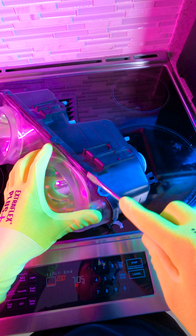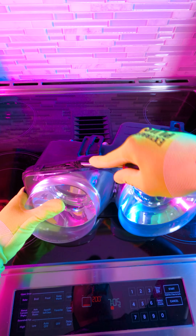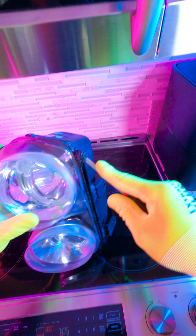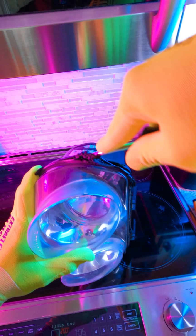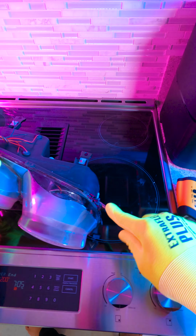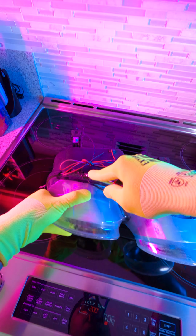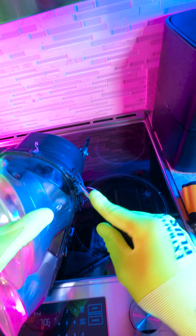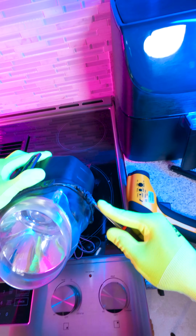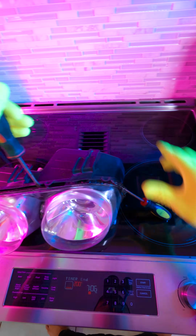Now we're gonna take our screwdriver and we're gonna run it around the headlight. Okay, we're just gonna go on the sideway action like this. Now don't poke yourself because that could happen, but that's why you have gloves too, right? So just go around the whole headlight. Now we're not trying to remove the butyl glue, this black stuff that's on here, because we're gonna reuse that. You can buy replacement glue from the retrofitsource.com, so don't worry if you mess it up, but we're gonna reuse the old glue just for purposes of showing you guys how this works.